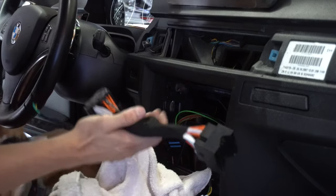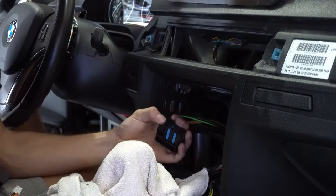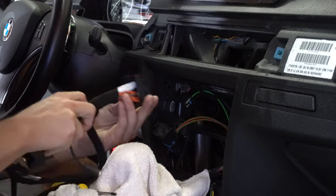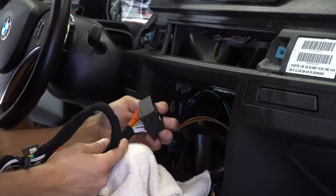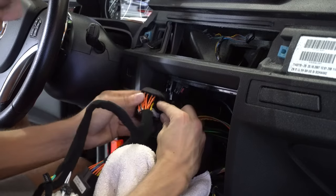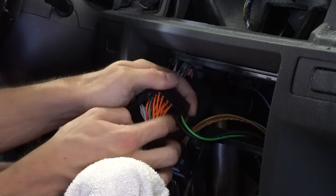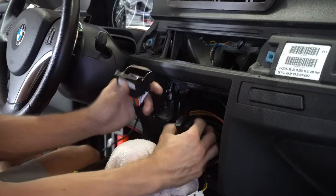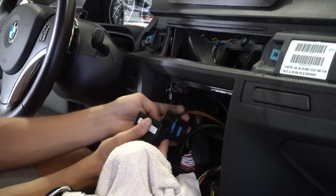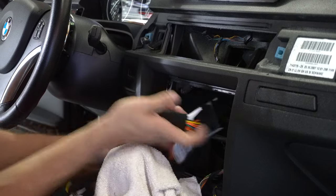This piece with the green and black wire is the audio cable. If you're having audio troubles, double-check these and make sure you swap them over to the new harness that comes with the kit. Pop out the green and black cables. Then take the new harness — the one with the yellow, white, and orange wires — and connect the black and green wire to the outside slot. Make sure the green wire is on the outside and the black wire is on the inside. Plug the female end of the harness into the OEM connector and swing the latch down.